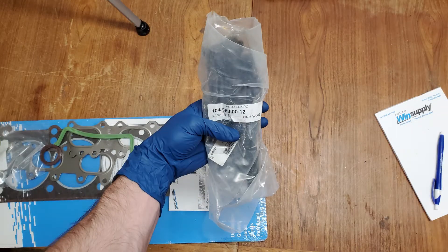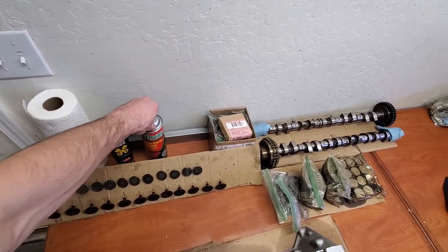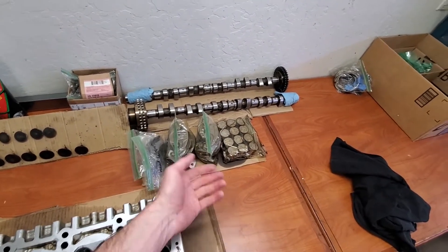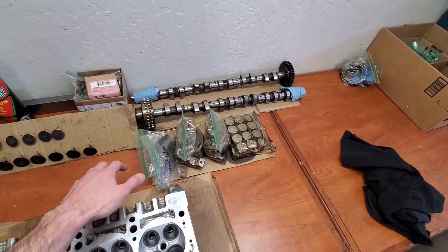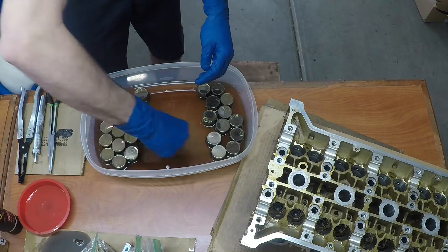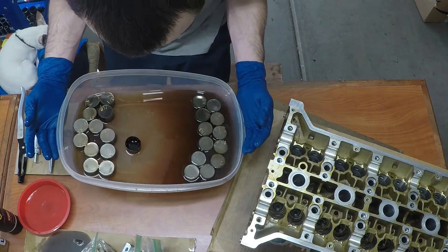A list of all parts and part numbers will be down in the description. We're going to be using some engine assembly lube, some brake clean, and some motor oil because I'm going to soak our hydraulic lifters in motor oil and swish them around — just to rinse them. I want to make sure they stay full of oil because they actually have some oil inside of them, but I want to replace the old oil with fresh clean oil. We're also going to be blowing some things out and rinsing things with WD-40. So first I put all of the hydraulic lifters into a basin, poured some motor oil in, swished it around, and made sure to keep the exhaust and intake sides separated from each other just in case there is a difference — although I don't think there is, but better safe than sorry.